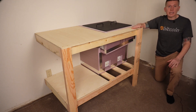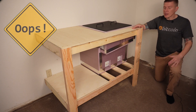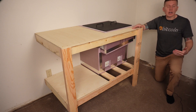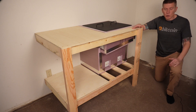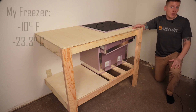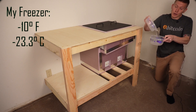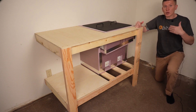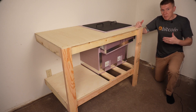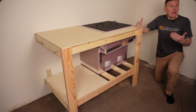With my tank design built and in place, I want to talk about things I got wrong along the way. Number one: in past episodes I made comments about dielectric fluid freezing in northern climates. That was me reading data online without anything in-house to work with. When I got my Bitcool delivered and put some in a freezer, I found it doesn't freeze solid — it actually flows pretty well. The fluid is a little thicker than at room temperature, so it may stress your pump a bit more, but it's not freezing and not rupturing anything. Definitely got that wrong.